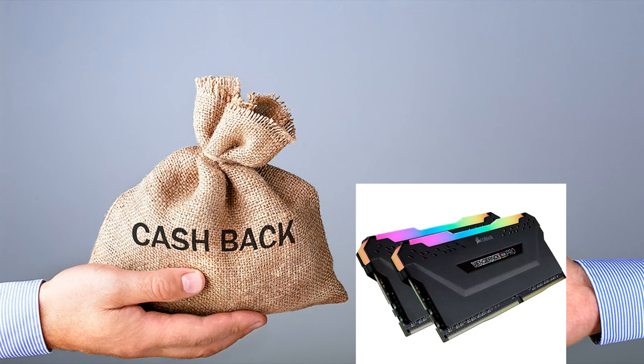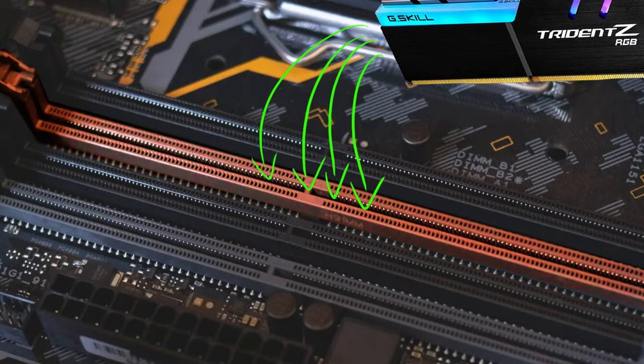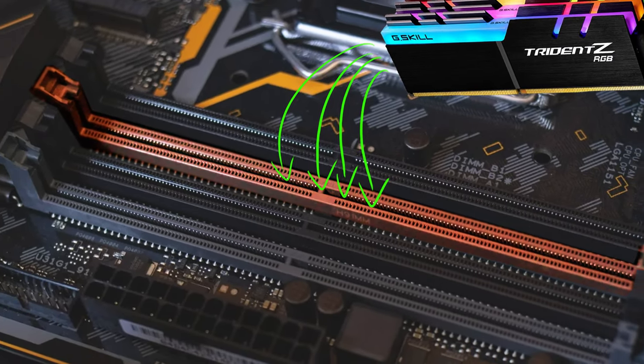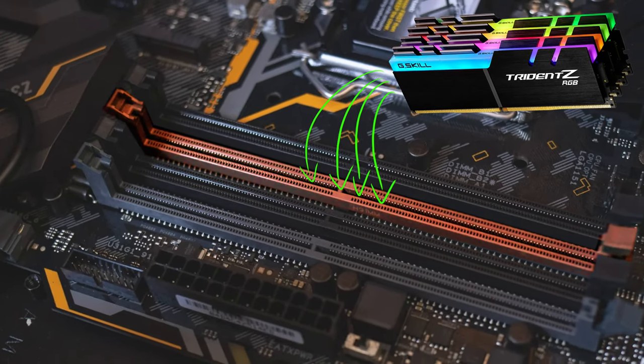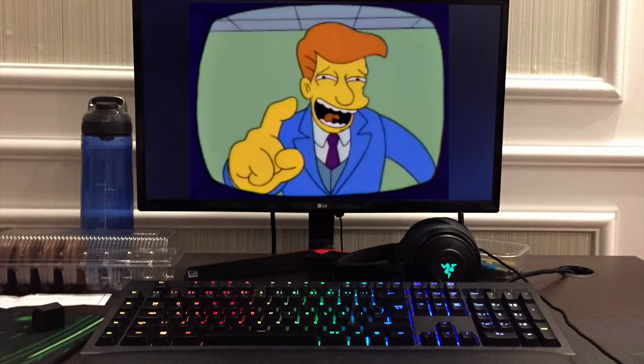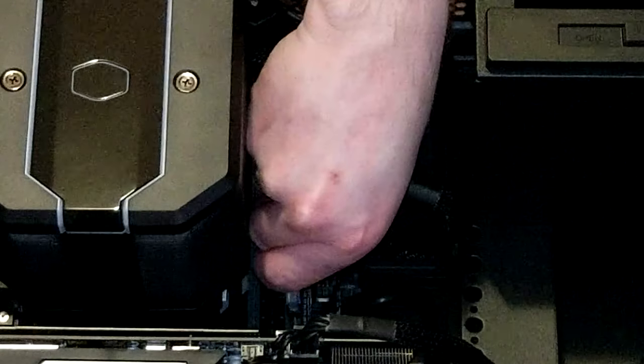This is extremely common, however. If you got it new, try to get it replaced or refunded. But if this doesn't solve the problem — as in you tried multiple modules in the same slot, verified this is the first slot your motherboard is supposed to have its RAM plugged into, cleaned it out, and the system still won't boot up — it's time to try out the next slot.